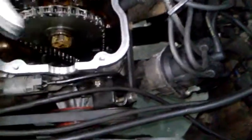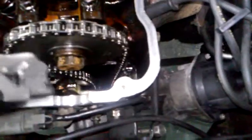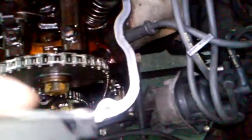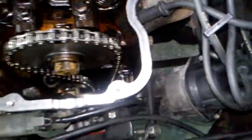Either way, I have to remove my oil pan to get the plastic junk out of there, and I'm going to do a full oil change too. But I'll show you guys what this will look like after I get done. This sits down in there like that — two bolts — which means I'd have to take the whole entire front part of the motor off, and if I'm going to do that I might as well do a full timing change service anyways.